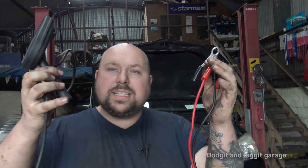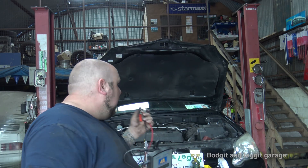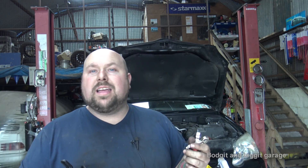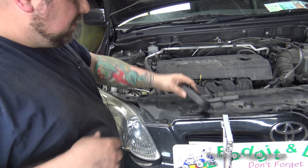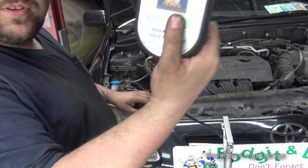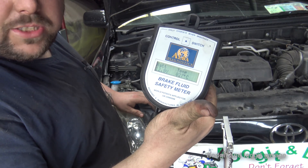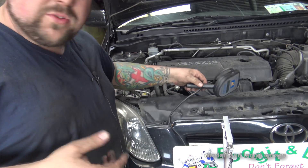The first thing I'm going to use is my brake boiler. It connects to your battery, you take the bottom off, put it in, press the button and it gives you the temperature the brake fluid is boiling at. This is a Toyota and I think the factory spec is around 150–160 degrees. We're going to replace it anyway because it's really black and horrible. First, we bang this on the battery — as you can see we've got a brake reservoir here. It's telling me the battery voltage and the machine temperature — 12.7 volts, so we've got enough to test.